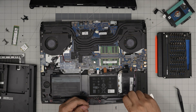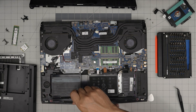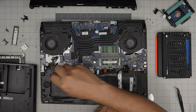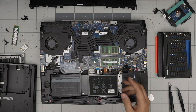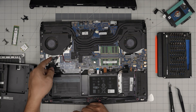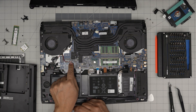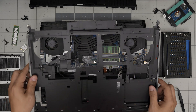The rest of the screws go with the bottom casing, so don't put screws where they don't belong — you can mark locations with a sharpie. If you want to replace the CMOS battery, it's right over here; it has an adhesive, and you just pull the jack backward to disconnect it, then plug it back in.